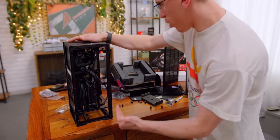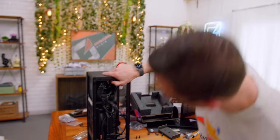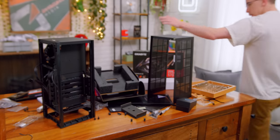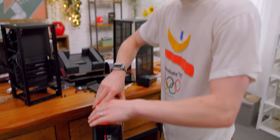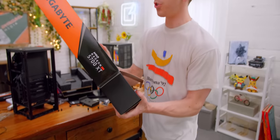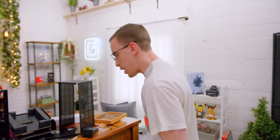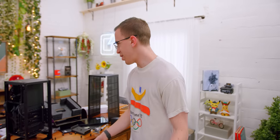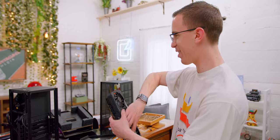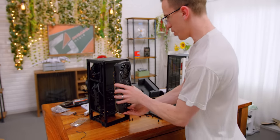So I have installed the motherboard, the memory — everything is here. We have our all-in-one cooler, which you can't see because as soon as you close it up it looks like a cabled mess. But you will be able to see where our graphics card is going to be vertically mounted — that is where our 5700 XT comes in. Now, I'm sure if you've watched our video about the Xbox Series X, you'll know that this is not quite as powerful as what you're getting in that system. It is AMD-based and RDNA-based, however this is RDNA 1.0, not 2.0, which means we do lose things such as hardware ray tracing. Theoretically we could have put something like an RTX 2070 or 2080 inside, but I wanted to try to keep this as close as possible.